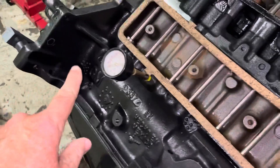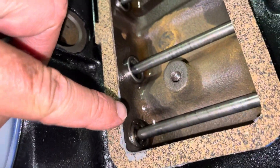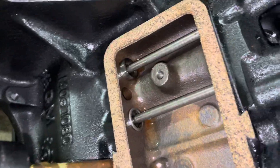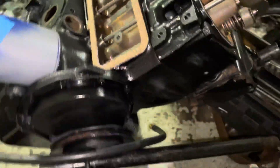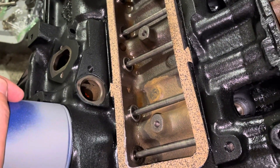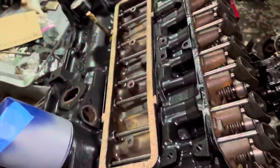Anyway, I spun it about 20 seconds and it built up to 40 psi oil pressure. As you can see, oil started to ooze out of these lifters up here on the top, coming out from the circumference of the lifters, which is normal. The reason I have the engine tilted at a 45-degree angle is I don't want this oil to run down onto the cork gasket before I have a chance to seal the engine up.